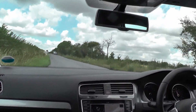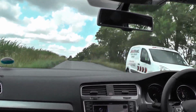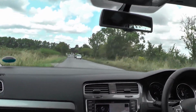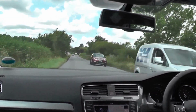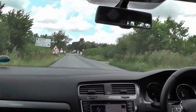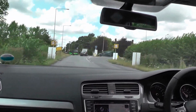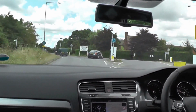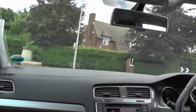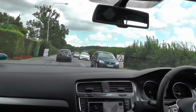Now I'm driving in the standard mode with no eco on or anything, but just with the maximum regenerative mode. That's D3B. So there's 4 modes. The basic result is you take your foot off the accelerator and you brake. Simple as that. And your brake lights go on, which can be a little bit disconcerting if you're behind one of these electric cars, of course, but hey. It's very effective in recouping power, so you maximize the range of the car and maximize your opportunity to get more power back into the battery from driving.